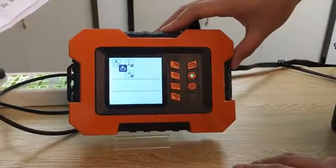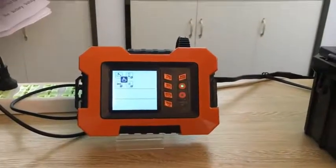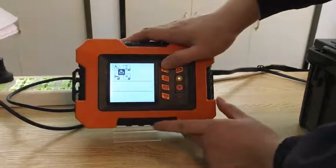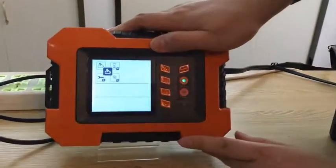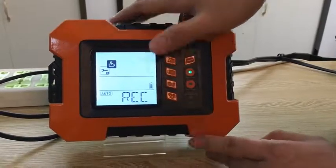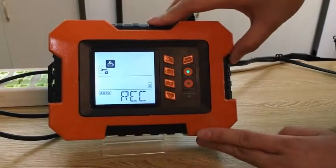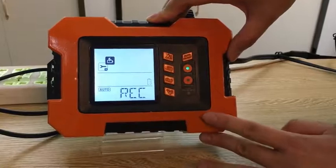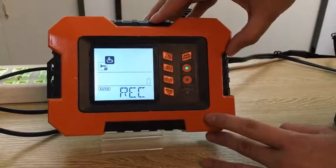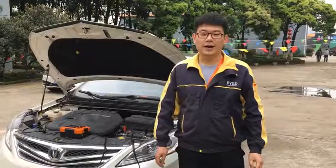The last charging mode is conditional mode. When a battery has not been used for a long time, the voltage will decrease and it cannot be charged normally. When you choose the conditional mode, the LCD shows 'REC,' meaning it is recovering now. When finished, the battery's voltage will show on the LCD again, meaning the battery is OK.